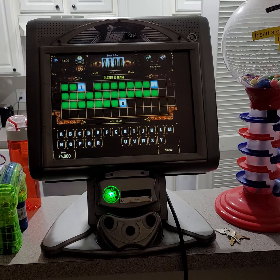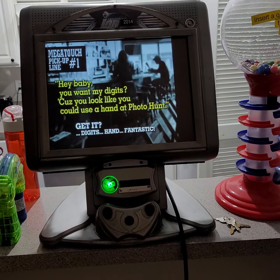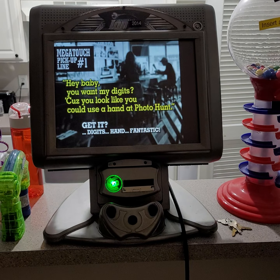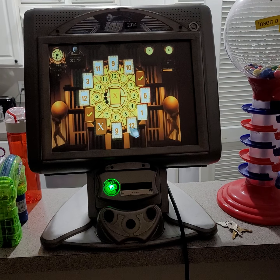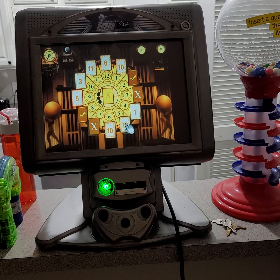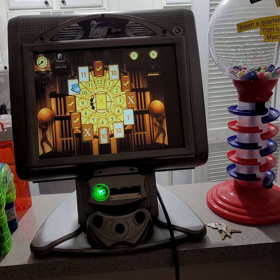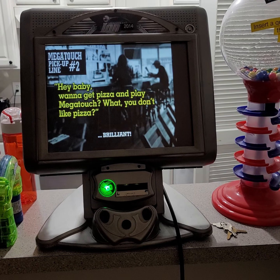When I turned on the Megatouch Arcade, I set the time and date after placing the CMOS battery — CR2032 button battery — then saved it after setting the time and date. I let it run for a couple minutes on its own automatically. Please be patient — then my Megatouch Arcade booted up successfully after waiting about a couple of minutes.